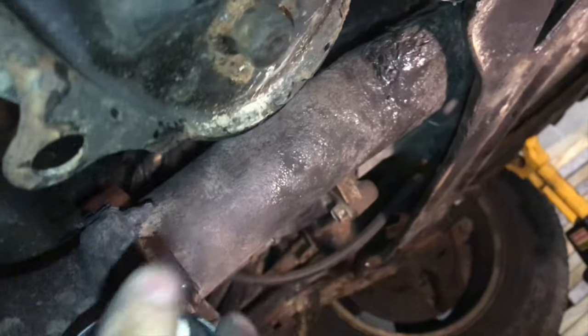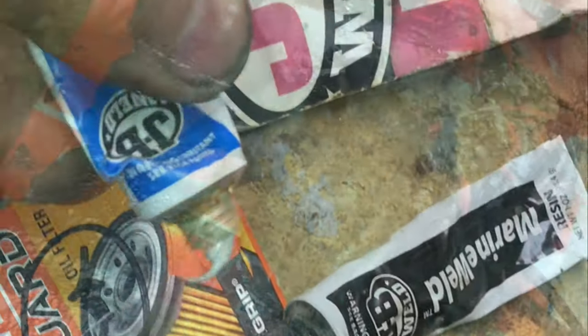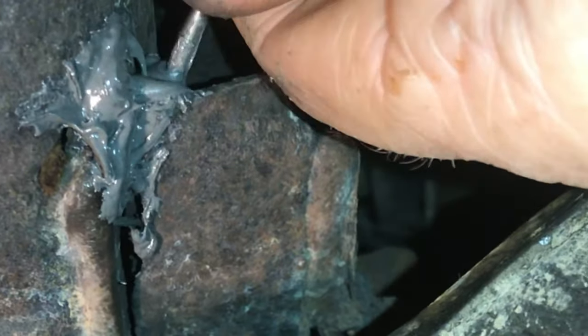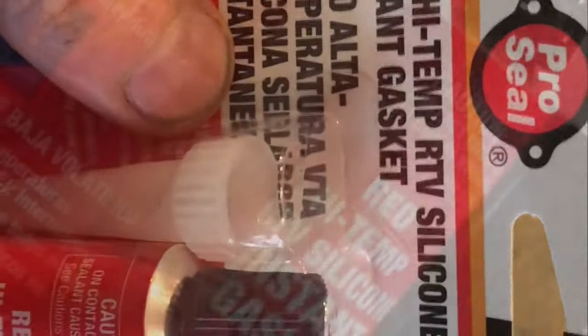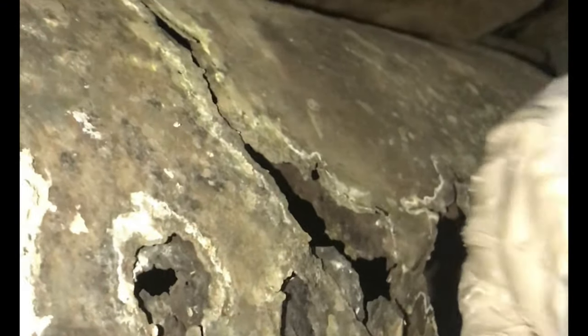If you put some black spray paint on there you won't even see it. There are other things you can try — JB Weld, for instance — but if you put it on before the catalytic converter it's just going to burn right off; it might last a couple days and smell terrible. Sometimes silicone will work — it doesn't stick that well and kind of blows through — but sodium silicate works.